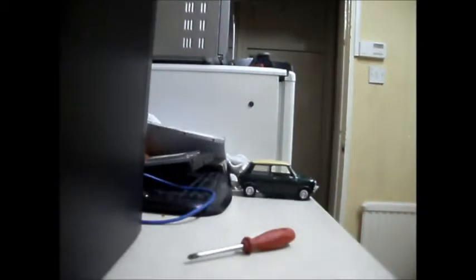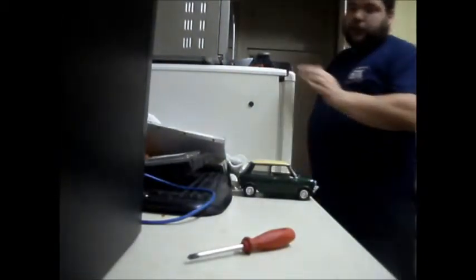If you're wondering what I'm now doing, I'm magnetising a screwdriver. It's an old hard drive magnet, and I'm using that because it's a good strong magnet. All you've got to do to magnetise the screwdriver is run a magnet on there like that. Then, and the camera focuses. See? The magnetic screwdriver. That's why when I scrapped one of my hard drives, I kept a couple of the magnets. They're pretty strong magnets. Okay, that's going to make life a lot easier.